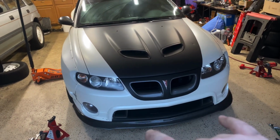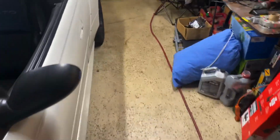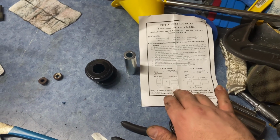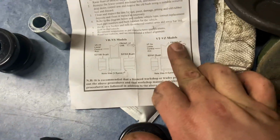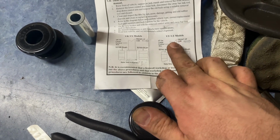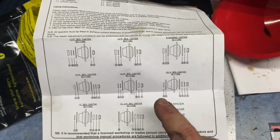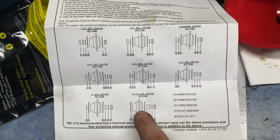I got an entire kit from Whiteline, which I will go back here and show you. Pardon the terribly messy garage, but I will leave links in the description below, but this is some of the instructions to go along with this. If you are unaware, this is a VZ model. GTOs or VZs, Holden Monaro, whatever, right? This is the radius rod to chassis instructions, and this one actually comes with a bunch of different washers, so you can adjust your caster. From the factory, I do not believe these are adjustable.